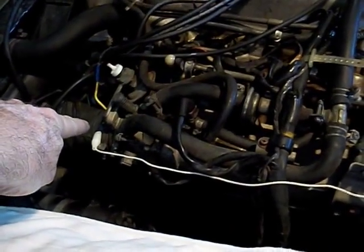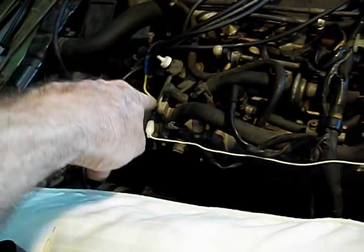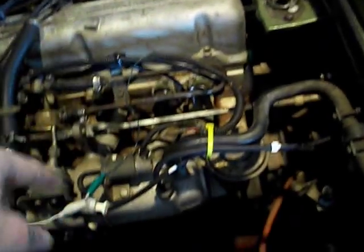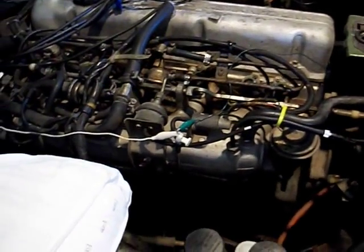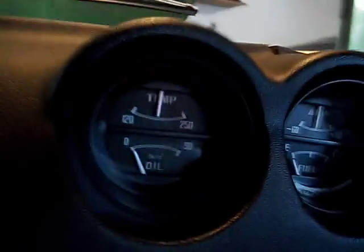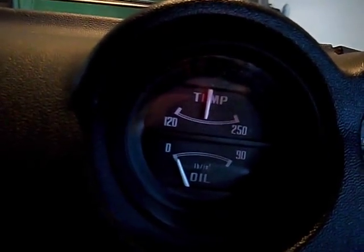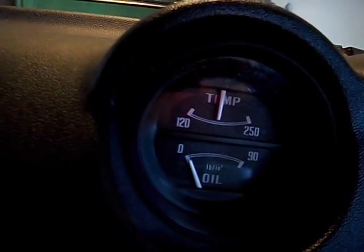So, 40 ohms — connecting to the cable harness that drives the temperature gauge, connected to ground with good solid connections. I checked the current and it's only about 100 milliamps, so I'm not too worried about the light gauge wiring. And as you can see, the temperature gauge is right dead center. So 40 ohms is where you want to be at 185°F on the temperature sending unit.